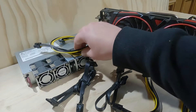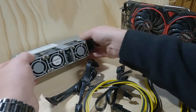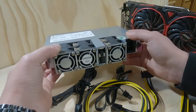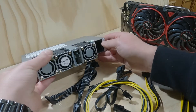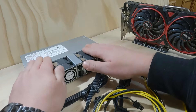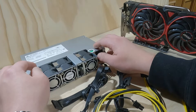The first thing I want to talk about is your power supply. Depending on what you've got, it could be an ATX power supply or it could be a server power supply. This one here is rated to 2400 watts and has a 94% efficiency. As a rule of thumb for longevity of the components in your power supply and in case something spikes, I always try to keep these at about 80%, especially for those ATX power supplies.